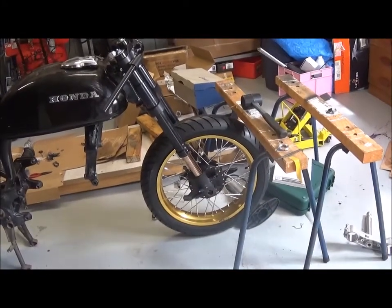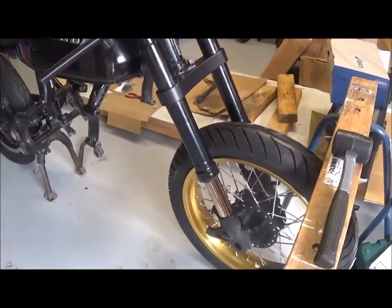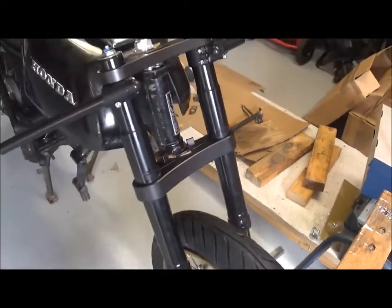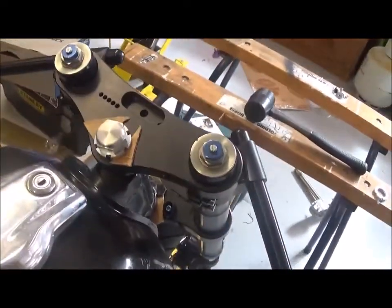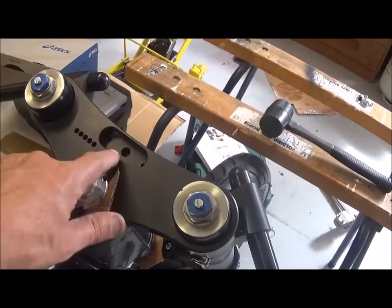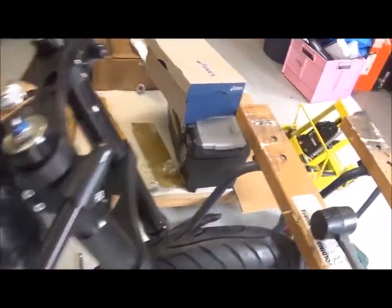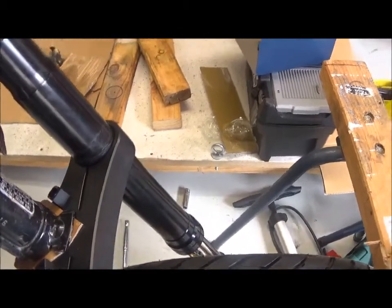That has turned this into a GSXR 600 or 750 front end. I've got the GSXR 600 forks — they're just tacked on, not screwed on completely. They also supplied the bottom and the top triple; the bottom triple comes with adjustable stops. I've put some clip-ons on — that's the top clamp — and there's a little space there for some instruments from MotoGadget, the mini scope, and some lights. I think I'll have an adequate turning circle without any problems, and I'll just adjust the little stops so that they hit the existing bracket on the front.